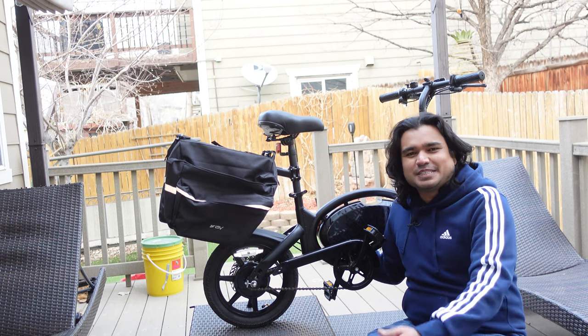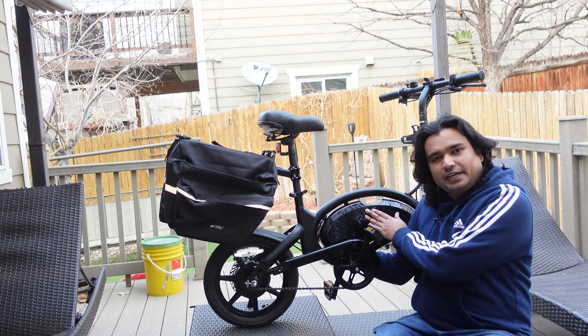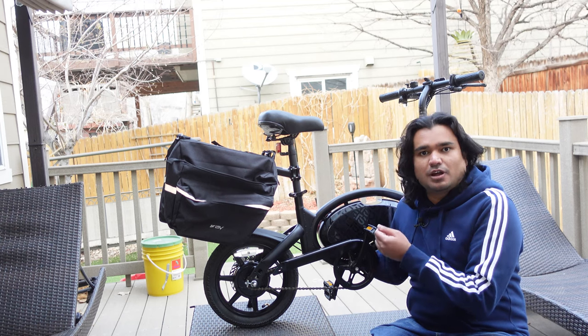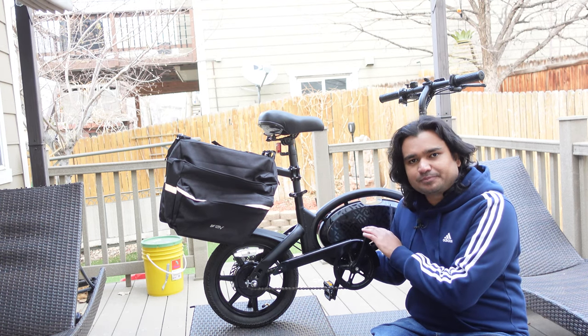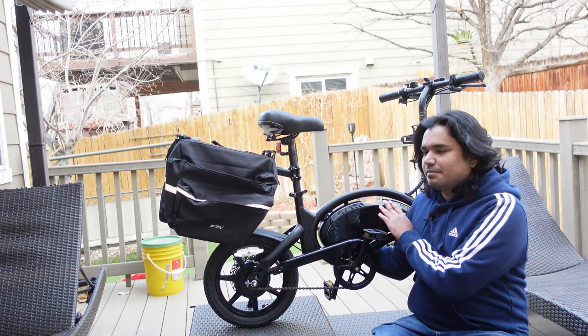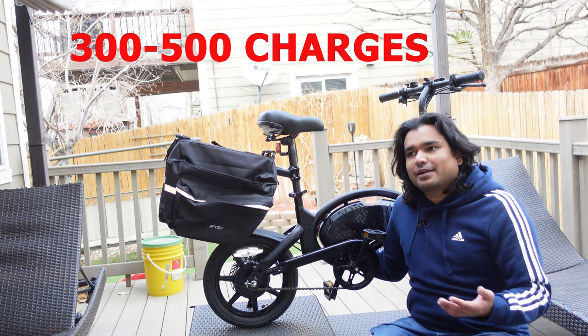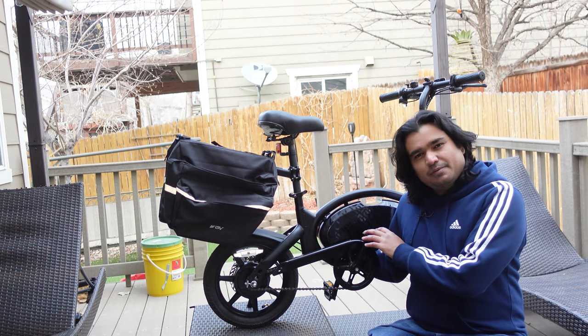When my battery really dies, I'm not sure what I'll do — I might just use it as a pedaling bike and purchase a new bike, because replacing the battery on an older bike is going to cost half the price of a new one. Lithium-ion batteries like in this bike typically last one to two years or more depending on how you use and store them. For this specific battery, they estimate 300 to 500 charging cycles before it goes bad.